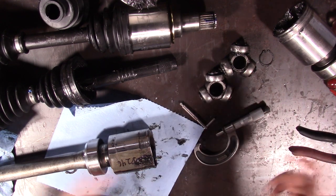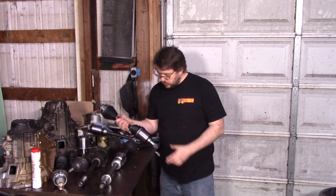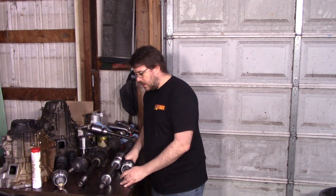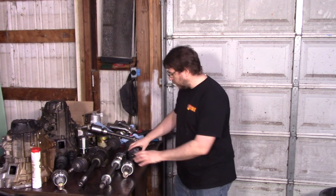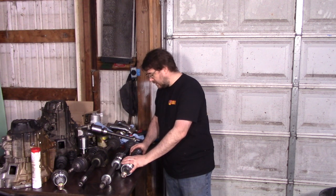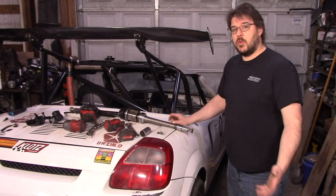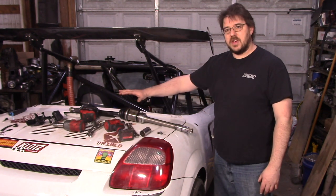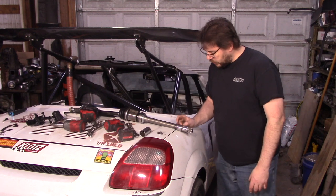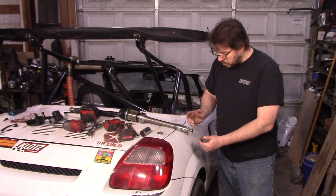Let me get this stuff out of here and let's put our axle together. So what we ended up with here is two axles that have the correct splines, but are both slightly longer than what we started with before. I know that one side being slightly longer is actually going to be a very good thing because we were definitely further out on the joint than we should be. On the other side, well, we'll just have to find out if it's a problem or not. So let's get the car in here. And we're now in the next day.